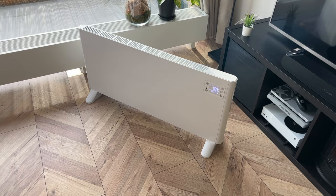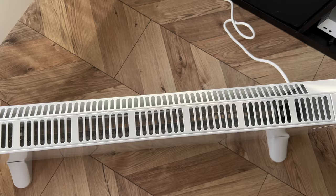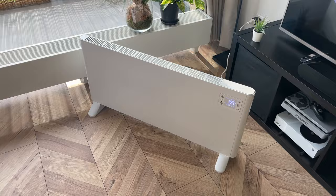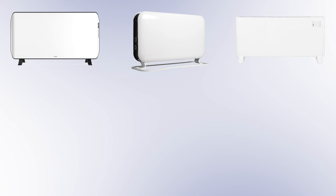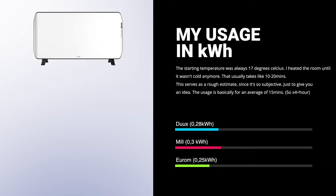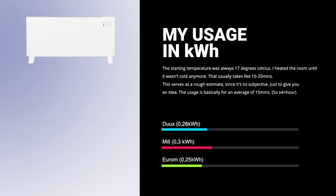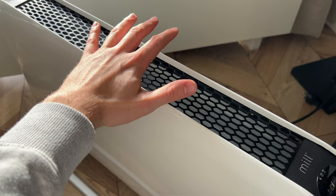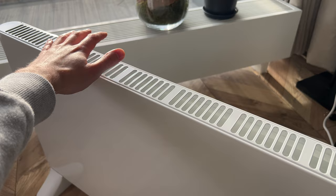Do I have something positive to say about the Eurom? It does seem to heat up the room the fastest out of the bunch — why exactly I'm not sure, but because of it you can use it quickly and turn it off again, and that shows in the usage data. I tested all of these in my working space of about 9 square meters with a tiny window, starting at 17 degrees Celsius and heating to 20 degrees Celsius using a smart plug. The Duke's Edge used 0.28 kWh, the Mill used 0.30 kWh, and the Eurom used 0.25 kWh — pretty even overall, but the Eurom did heat up fastest, in around 10 to 15 minutes.